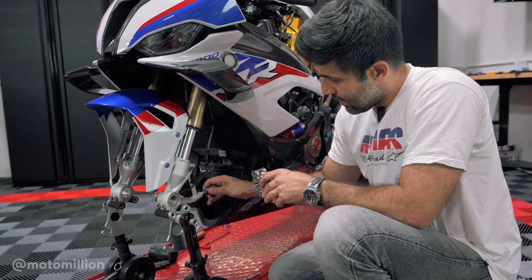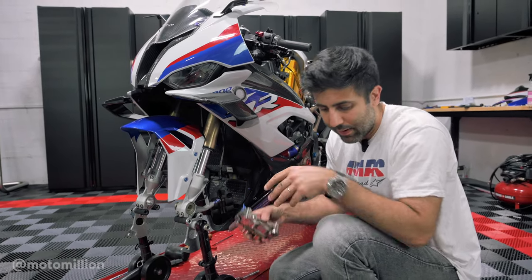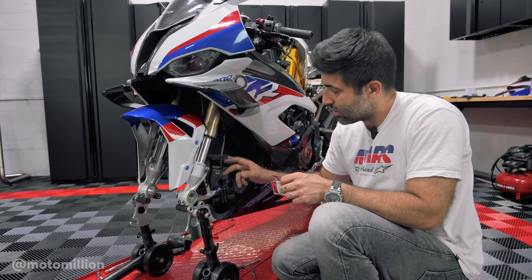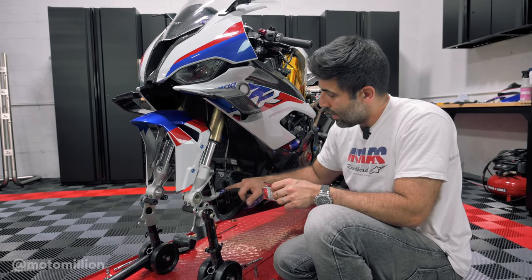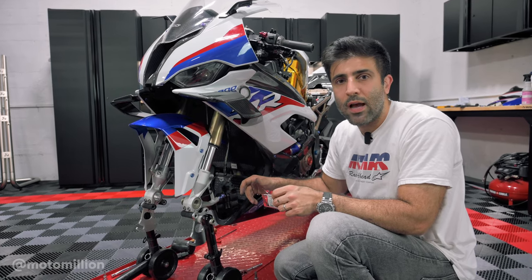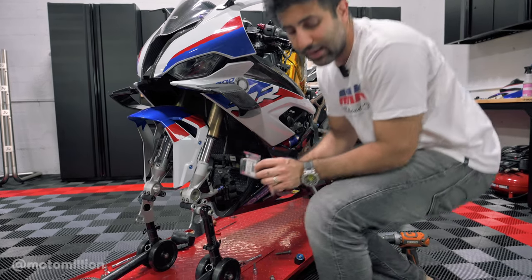What I'm doing is putting a bunch of titanium anti-seize — which is a ceramic anti-seize paste that comes with the ProTite bolts — and I'm running it in and out of the fork legs just to make sure we get enough anti-seize on here. Aluminum and titanium tends to bind together over time and they fuse, and you don't want that to happen. That's why you want to be liberal with this anti-seize paste that comes with the ProTite.